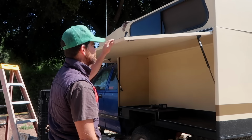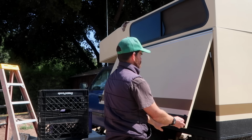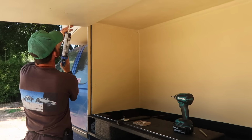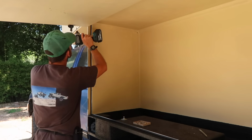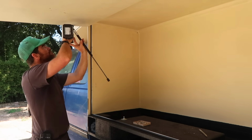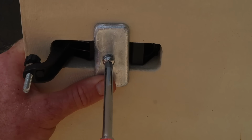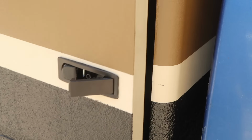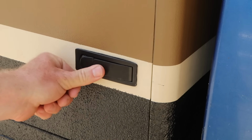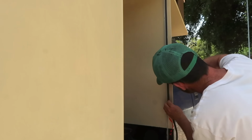It opened and closed smoothly without being too much to close or causing the door to spring open when you open the latches. So, with my mounting location finalized, I remounted the ball stud brackets with Sikaflex 221 and number 8 panhead screws. The compression latches were installed in the surf hatch and utility hatch doors, and an EPDM foam rubber seal with self-adhesive backing was applied to the aluminum trim to create a watertight seal.